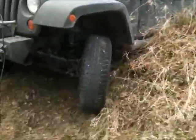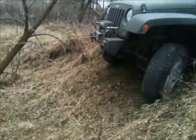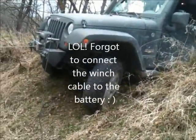Really, all I'm trying to do here is slide it along the grass to get a bit more traction. So I'm going to step out of the way at the front. I've locked my spool clutch to in, so I'm going to spool it in now. I'm going to clear myself way away from the Jeep and its forward motion. Notice the tires are angled this way. I want to get out of that. And let's give her a shot. I just want to inch her forward a bit.